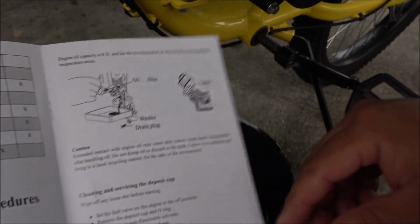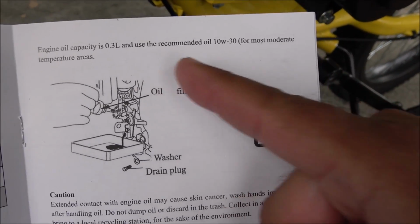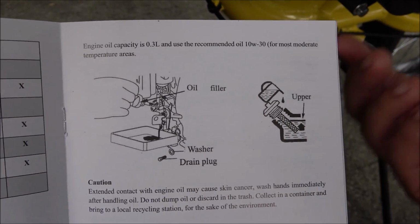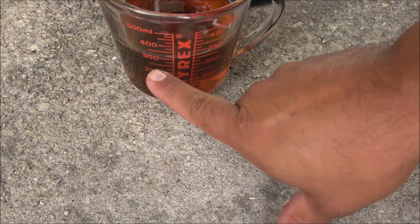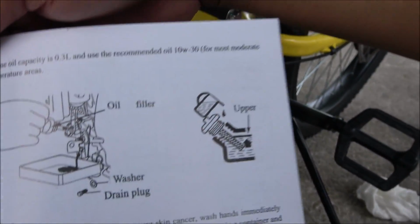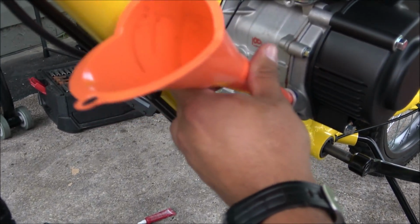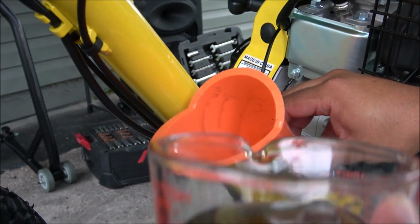As per the manual, this engine can take up to 0.3 liter of oil. So that's equivalent to 300 milliliters. So I have this measuring cup, and I took it to the exact 300 milliliters, which again is equivalent to 0.3 liters. Insert your funnel like so, and now pour the oil